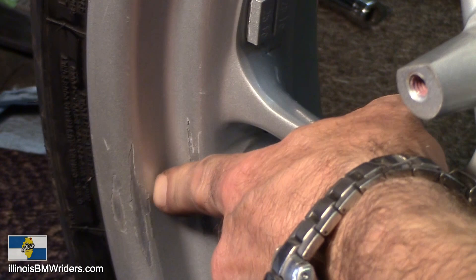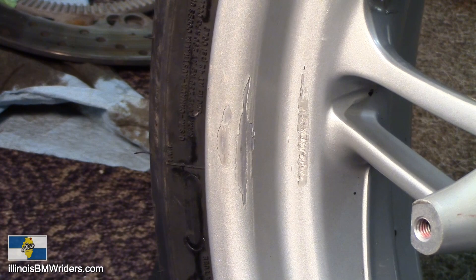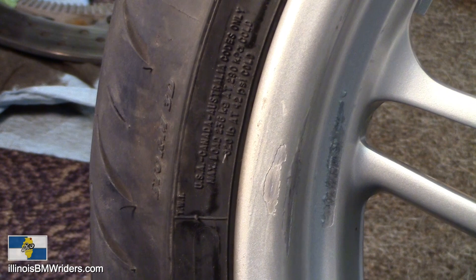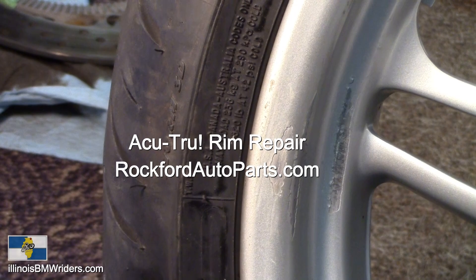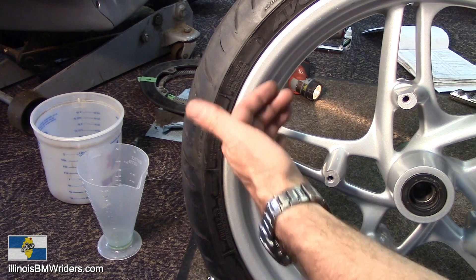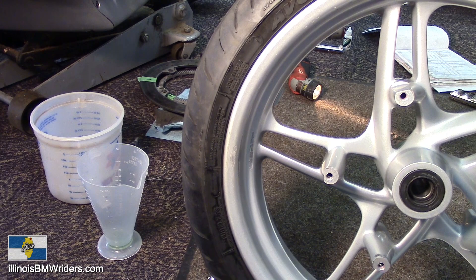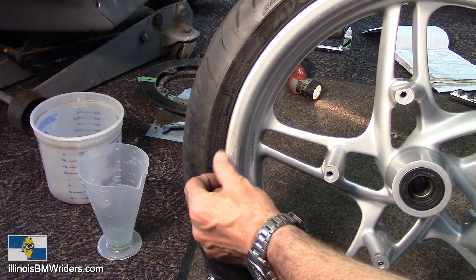I do not care about that a bit — I am just way more happy that the rim is totally straight the way it's supposed to be. It's absolutely rounded here. They have a special machine — I think it's called a True something or another — it's a special machine that's only in a handful of places across the nation, where they're able to push these rims out without heating them up. Usually what they'll do is take a flamethrower or a cutting torch on the backside of this, really heat this up — it winds up completely discoloring and marring up the finish. I would rather just pay the money to have somebody press it out the correct way using almost no heat at all. There's no heat damage on here, just some scarring from whatever the jig or tool is that they use to press against it. I'll have this thing refinished in the wintertime when I'm not riding the bike.